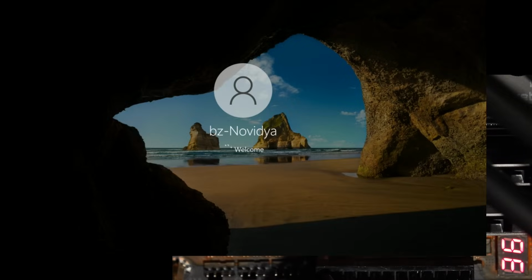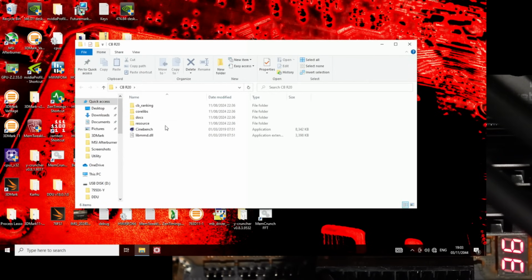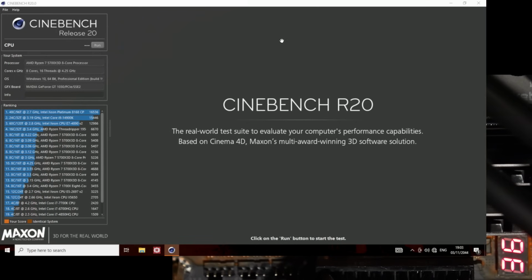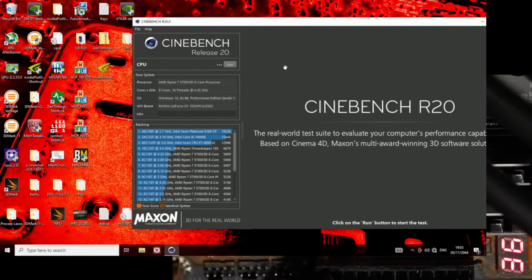But you can kind of tell at this point that this is really on the knife edge of stability. And I don't think it's the actual core clock doing it. I'm pretty sure it's the memory controller or something being very upset about the BCLK not being 100 megahertz. Really makes me wish, because on AM5, the workaround for this is that you just use ECLK. And then you don't have to deal with all of this wackiness from BCLK overclocking.